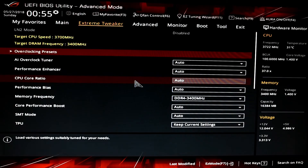I also had a look very late in the evening at the Precision Boost Override functions in the BIOS. It seems that Precision Boost Override is more intended for more exotic cooling — high-end air cooling, a custom water loop, or AIO. As it stands, the three different modes the clocks were tested in were: stock, ASUS Level 2, and Precision Boost Override — tested in synthetics like Cinebench R15 and 3DMark Firestrike and Time Spy, as well as a couple of games.